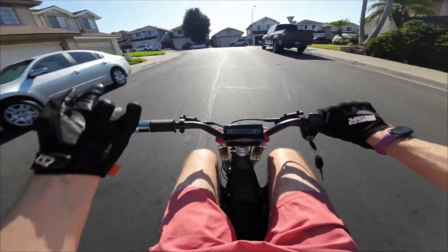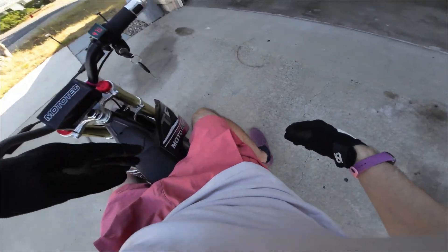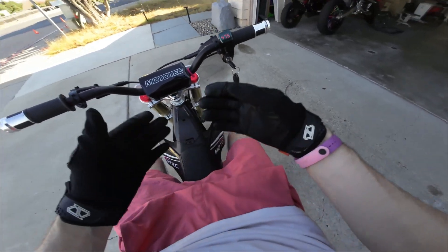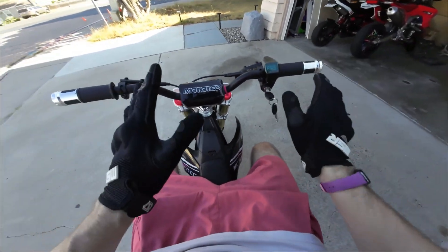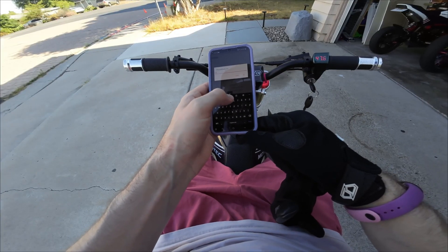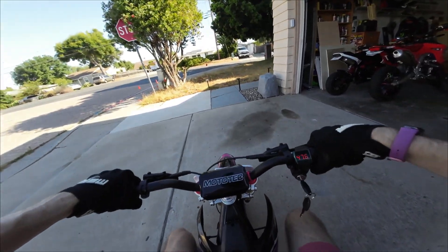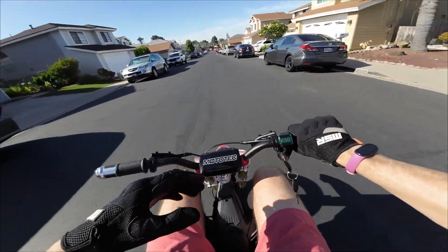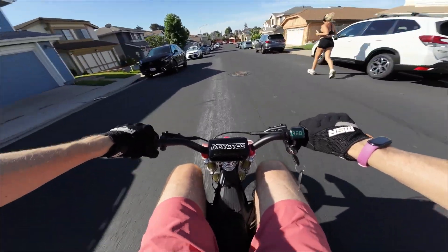So let's just do it all over again. Tried 255, then I started doing increments of 20 just to save time, and now we're at 215. I just turned it on and it sounds horrible. So definitely not the case. We're going to put that back up to 275. Much better — still crunchy, but it's acting like it should be. So phase offset was not the right call.